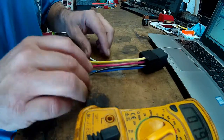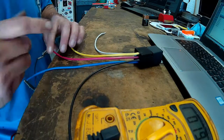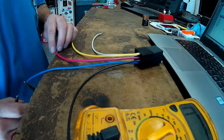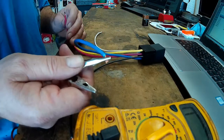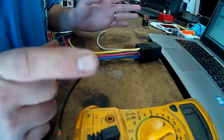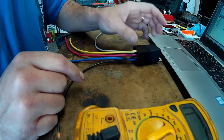That's the center pin on your relay. And as the meter is sounding off here, we know that that's a continuous circuit. So if I put 12 volts power here, I'm going to get 12 volts power out here all the time without triggering the relay, without doing anything. So that's called a normally closed circuit.